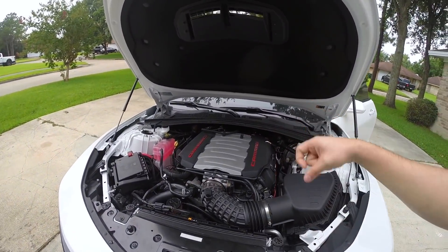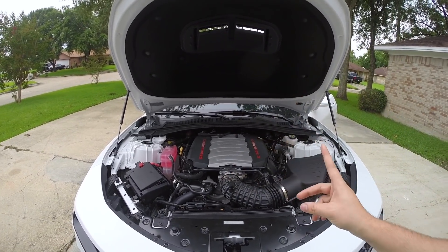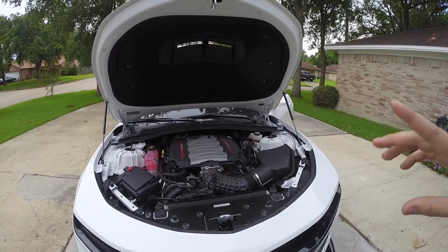There are various kits out there. I've got a video linked in the top card of me installing the E85 sensor — that is part one. So we've already installed the sensor; now we actually have to activate and enable the sensor from the computer, since this car did not come with the sensor installed from the factory. The sensor in the computer is actually disabled, so we had to get an update from my tuner that would enable this sensor while also populating the fields so that I can run a mixture of pure gas or E85 based on the alcohol content that the sensor is reading.